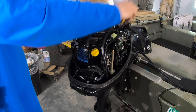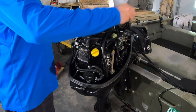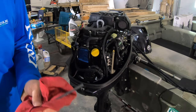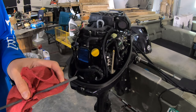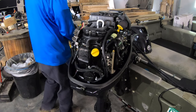The only thing I'm wondering is if there's any oil in that filter and if there's not, how low it's going to go. So I'm going to bump this — I'm not going to start it, just turn it over. Okay, that should have circulated some oil. Let's see what we've got now. It's barely below the little dot — right there where my fingernail's at, and there's the dot for full. I don't want to overfill it, and of course you should always check your oil before you go out.